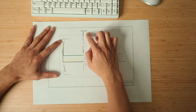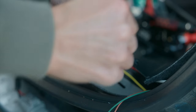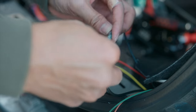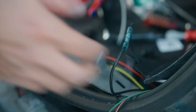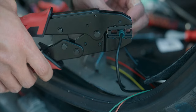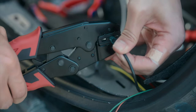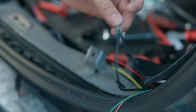After you mate the two connectors together, you're left with a black unterminated wire that you're going to need to terminate at the fuse module that's also included. The fuse module they include is terminated with red wires. There is a butt connector already installed on one end. It doesn't matter which side you use since fuses are not polarized. What's important is you use a butt connector to connect the 12 volt to one side of the fuse, and another butt connector to connect the other side of the fuse to the battery input of the stealth hitch control module.